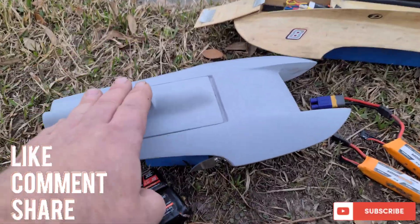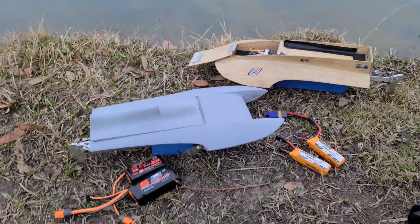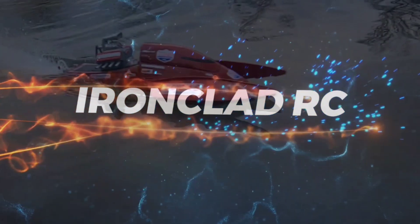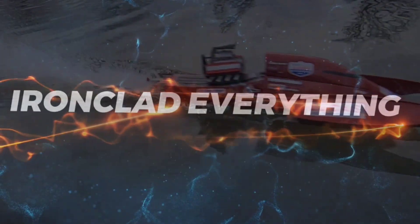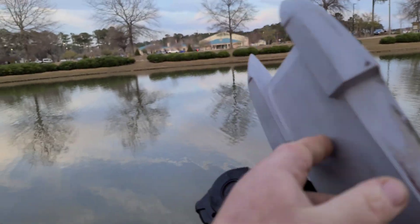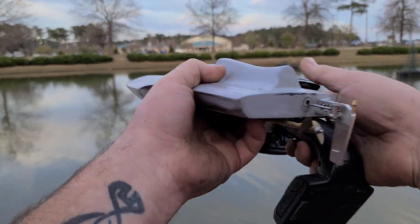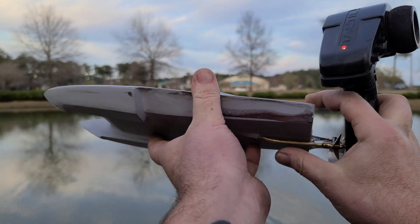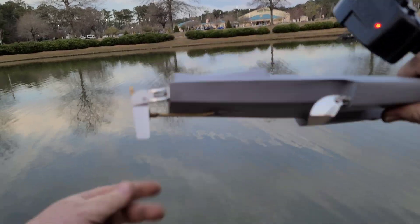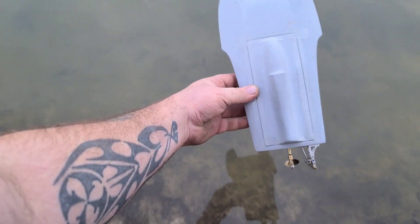Let's get it — first run with this boat, first run with the new electronics. It's the maiden run. I need to paint the boat; I'm just running it to make sure my ride pads are good. I've been doing some sanding off camera. I got my strut level with the ride surface and my micro turn fin should be on point. I've got a 30-millimeter prop on here.